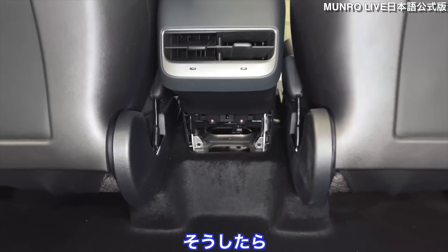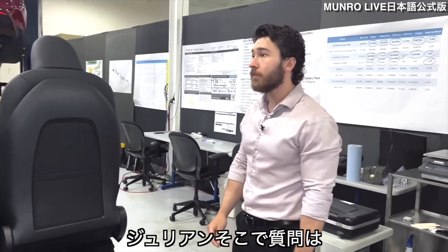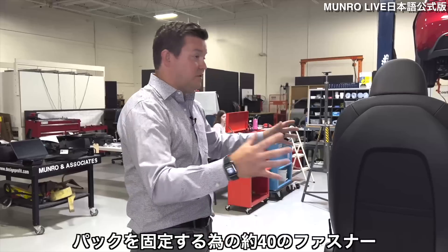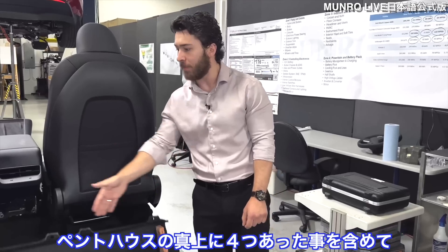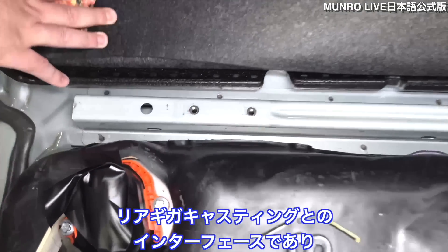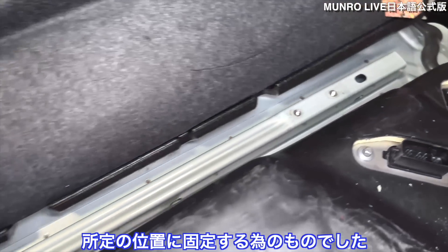Then you can handle your low voltage connections from the center console to the instrument panel. So you said 38 bolts plus two, about 40 fasteners to secure the pack. It's 38 securing the pack, including four just above the penthouse here — these interfaced with the rear gigacasting on the vehicle. These were the only structural bolts on the interior of the vehicle. The rest were for securing things like the center console in place.